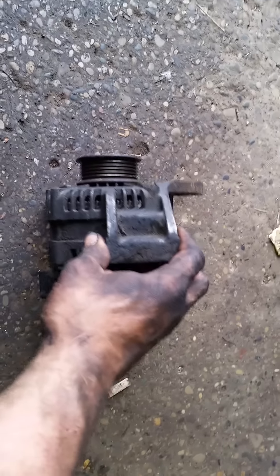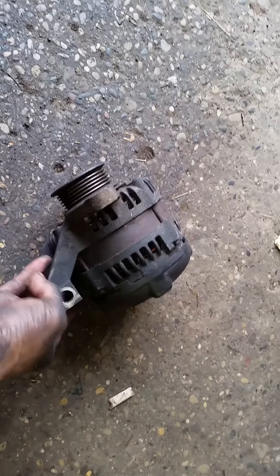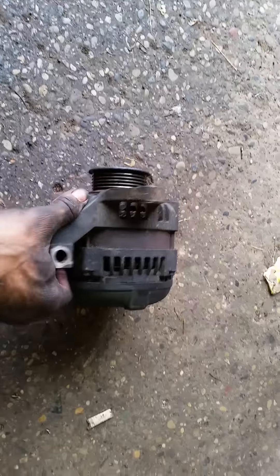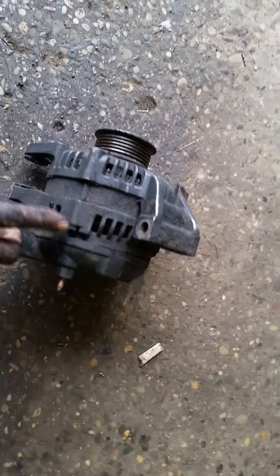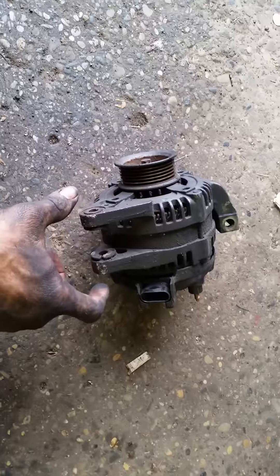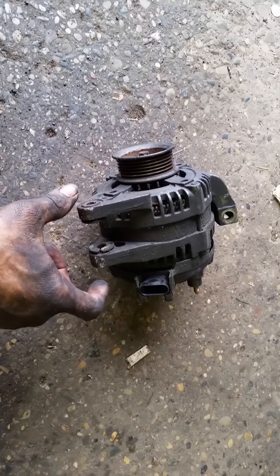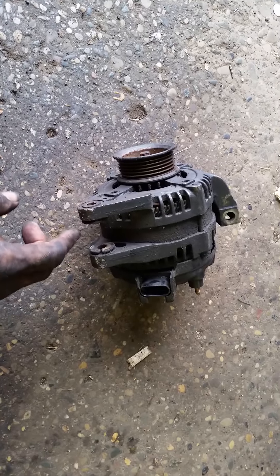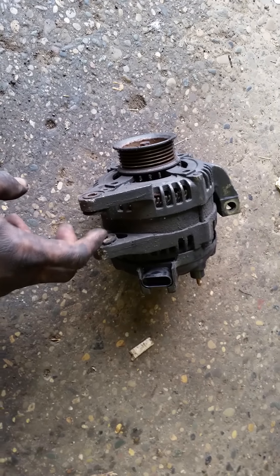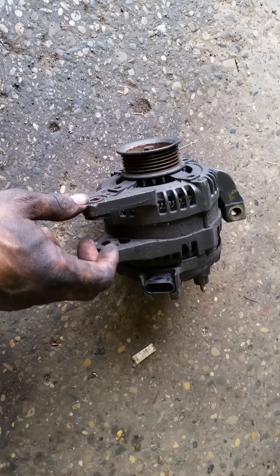I will show you them because I have the old alternator here. The alternator sits in there pretty much like this. This bolt you can get to from the top. This bolt down here at the bottom is actually like a pinch bolt — all you really have to do is loosen this up. One of the problems that happens is when you tighten this bolt up, these come out. They're designed to do that — they're designed to lock it in there.